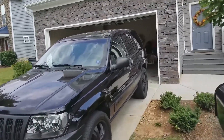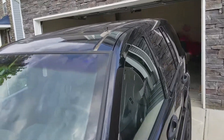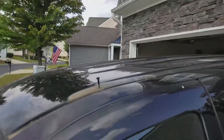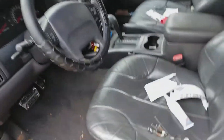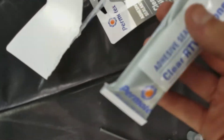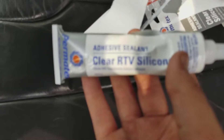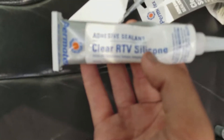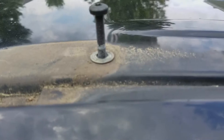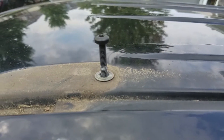Alright guys, so I deleted the roof rack — a little dirty from where it was, but I'm gonna have to clean it another day because it looks like it's trying to rain. So I'm gonna fill these holes with these screws. I am putting some silicone on there. We actually used threadlocker before, which is the same thing but it's gonna be really hard to get off. I just put in a little bit in there and then I'm gonna tighten the screws down all the way and it should feel pretty good.